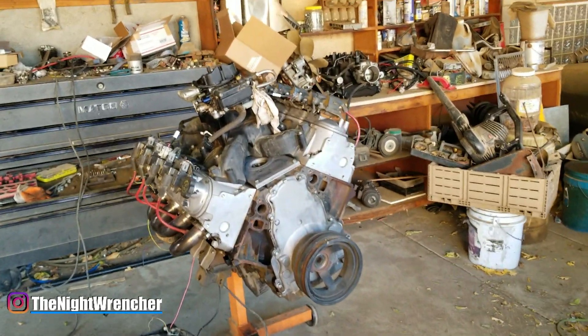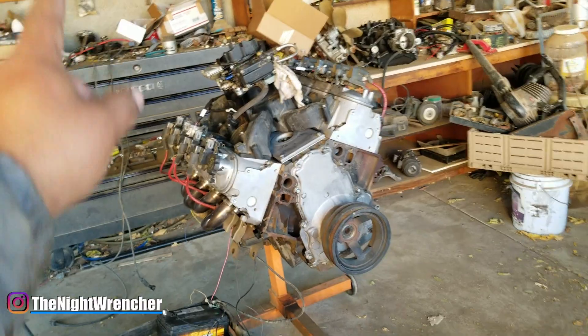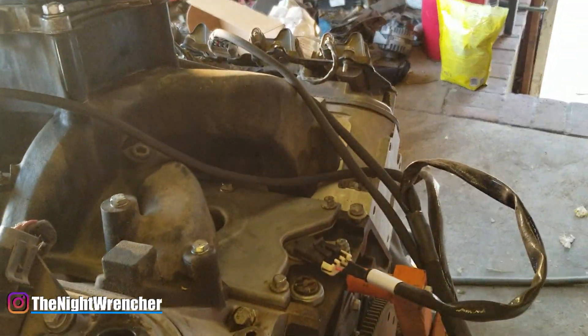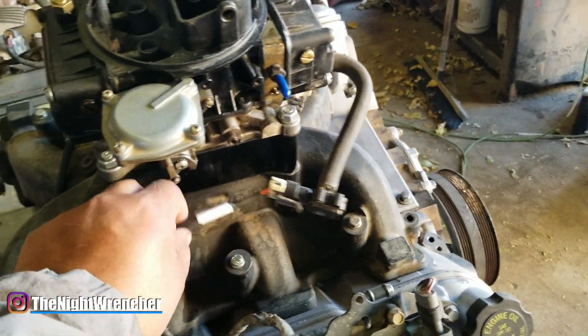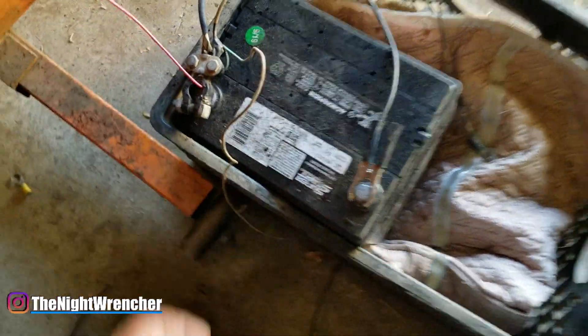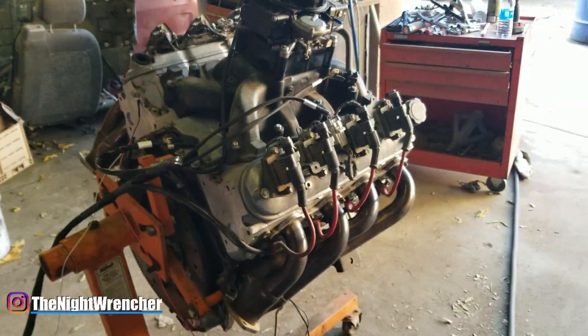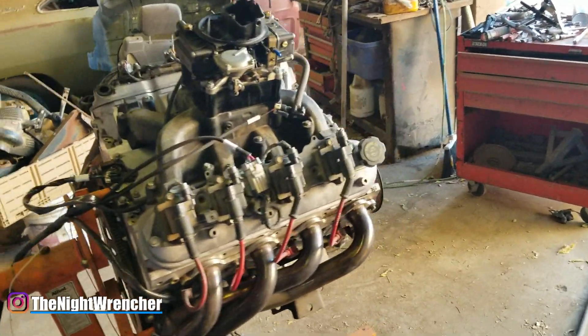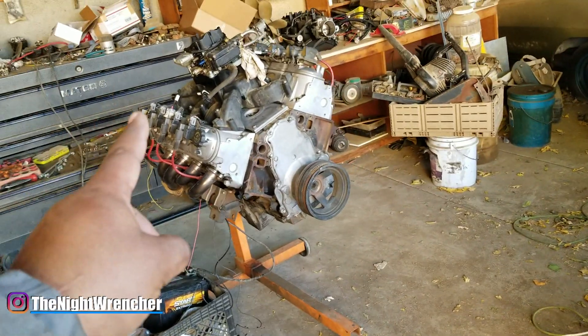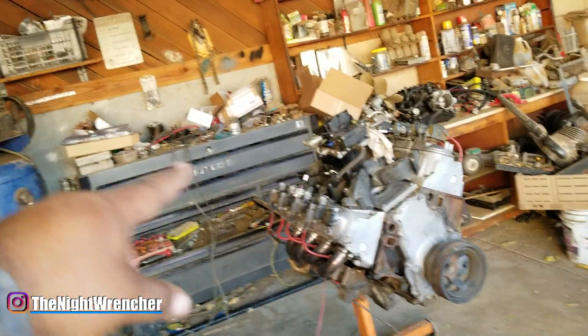As you can see, it did run. It had a slightly longer crank, but it actually ran really well. I didn't bother changing to the front sensor at all — left it completely stock, using the rear cam sensor. Installation was super fast, probably not even 15 minutes. I borrowed a hose off the stock truck intake and got all the stock sensors working properly. The only things I hooked up were power and ground, then returned the ground from the block to the battery. For anyone asking whether this works on a regular Gen 3 — yes, it will run. You might have a longer crank time, but it'll start up, and you don't have to spend another $100–$150 on a front cover conversion.